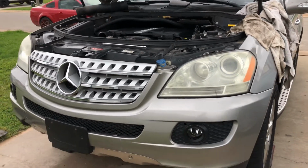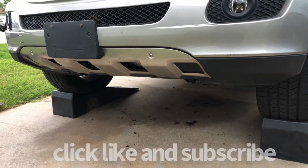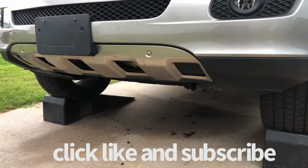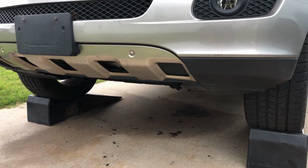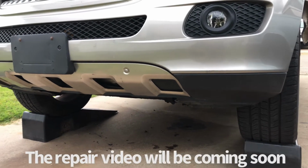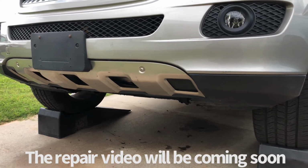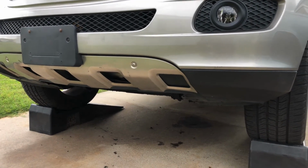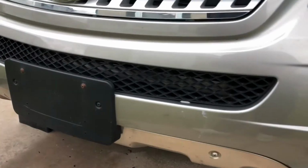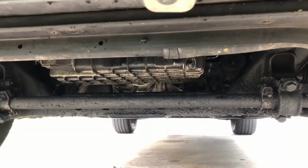Now, pulling off the skid plates, everything underneath so we can get to it. Figure out what I'll need to do to take the front of the oil pan off, get to the oil pump. I know I need to take everything off inside the engine compartment, such as the alternator, power steering, because I need to change timing chains as well. The oil pump runs on timing chain gear. But for now, this thing is so greasy under here. Gonna degrease this first.